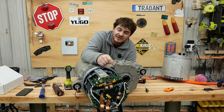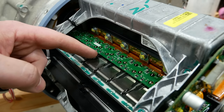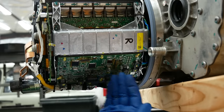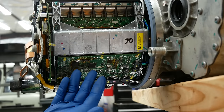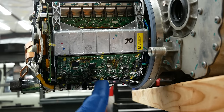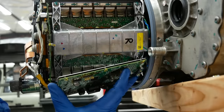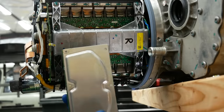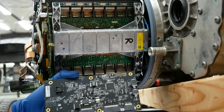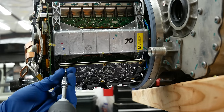I was looking at these inverter boards thinking, 'Wow, that's a lot of epoxy' — but that's not epoxy! It's some sort of liquidy gooey stuff with a lot of sticktivity to it. The stock control board is the main reason we need to replace it: all of the torque limiting and mapping values are hard-coded onto this board and it can't change anything. Out goes the stock board, complete with the EMI shield. Here's the new AEM board — I can fully control this one. Plug everything in and screw back into place.